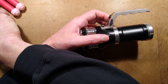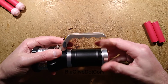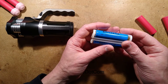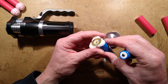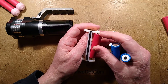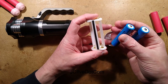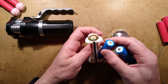I have to say I was going to use generic cheapy batteries I had knocking about. I'll show you the battery pack — it takes three cells. I've only got two in it. Cheapy ones, claimed to be 3000 mAh, actually 500 mAh. But it didn't actually come with batteries. The ones without the pip on the end are just a loose fit — they won't make contact with the contacts. So not a good idea, given they're all in parallel, to use something like that. Make sure you use batteries that fit tightly, or better still, just don't buy the thing at all because it has slight problems, as I shall show you.